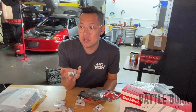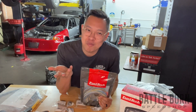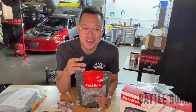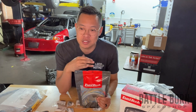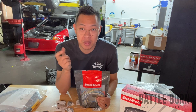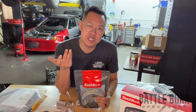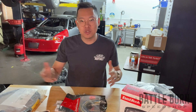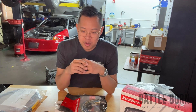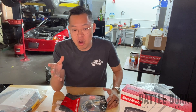If you're a DIY person like I am, you can save some money. If you know how to do it yourself, you could have a really badass standalone on a 450. You might go a little over once you factor in relays and other stuff, but a full standalone engine harness to power your car — flip a panel switch — you could do that yourself for under $1,500. That just runs your motor. Obviously if you want to wire in your lights, you can, but for getting your car working, it's super cool.